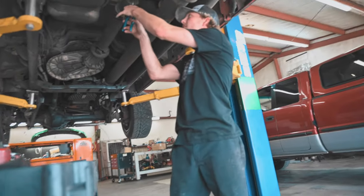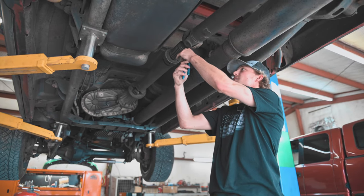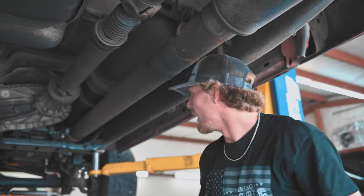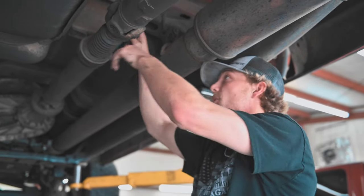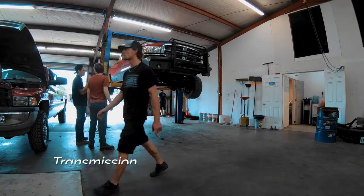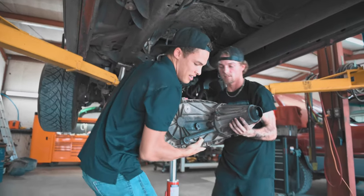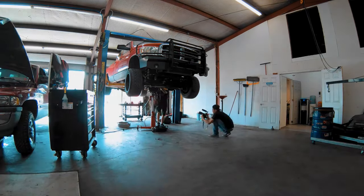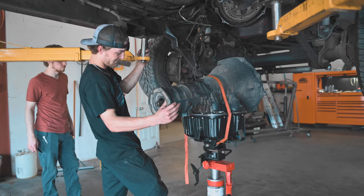So what all goes into taking something like this apart? You got to get the drive shafts off, the drive shafts and the transfer case, all the connectors and the shift cable off the transmission, and then you got to take the torque converter bolts out the front by the engine. She's ready to come out pretty much. Have you done it a few times? Yeah. Tranny's out. It's time for Chris to do his magic.